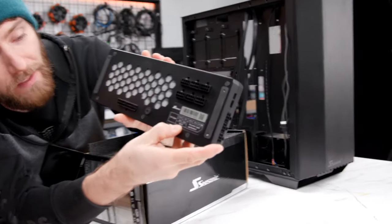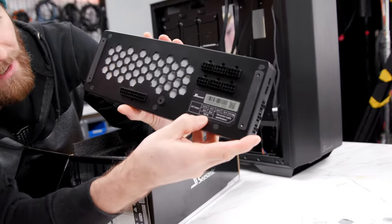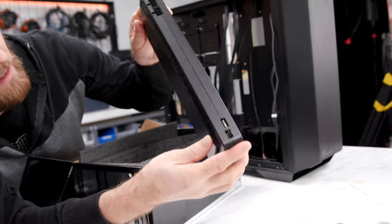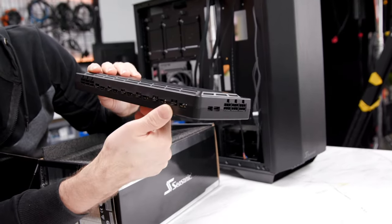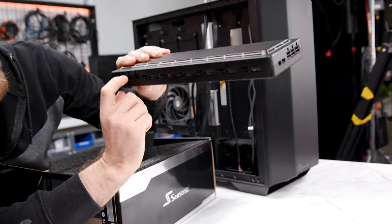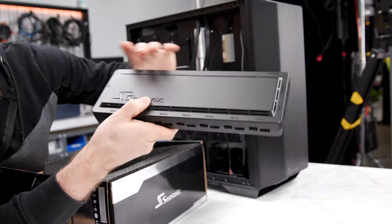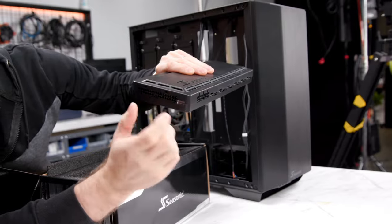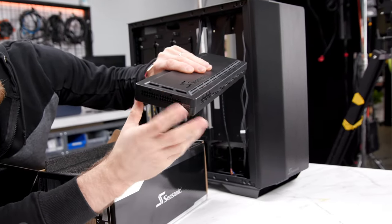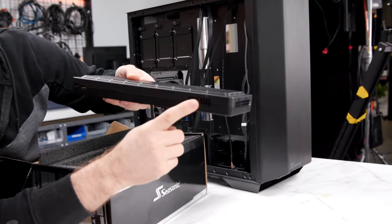So the power supply that goes in the bottom of the unit is actually 12-volt only. So you can see here, it's actually got RGB power as well as fan power. It's got your SATA and Molex over here. It's got the power supply inputs right here. That's it. So 12-volt power goes from the power supply into these two. And then you've got your CPU connectors.